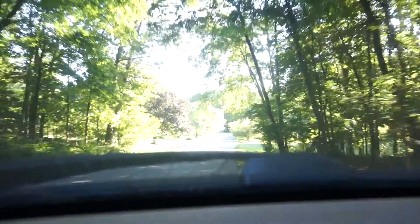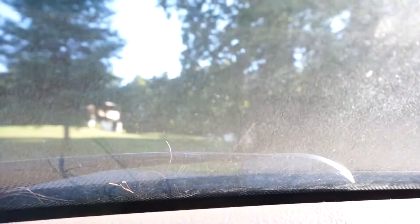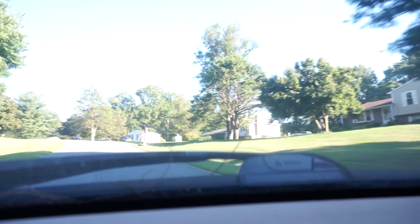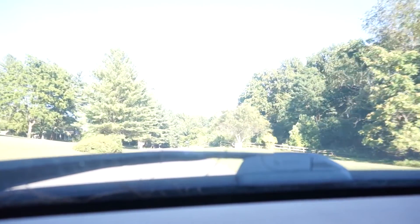Right now I'm just driving around the block with the camera sitting on the dash — second gear. It's got some weird low power issues right around 1500–2000 RPM where it doesn't want to go. But it drives. You can also hear some weird noises; I think that's from the geometry of the throttle body but I'm not positive. We'll take it around and I'll try to get into it — hopefully the camera doesn't slide off. Alright, wide open throttle here.